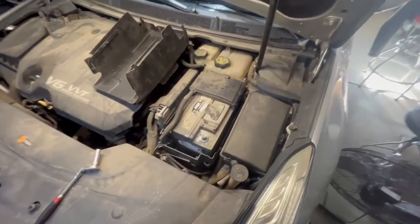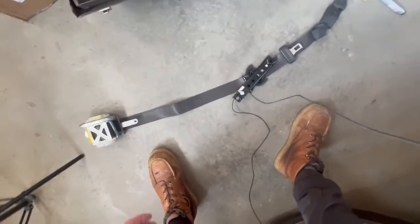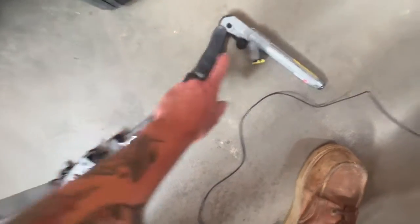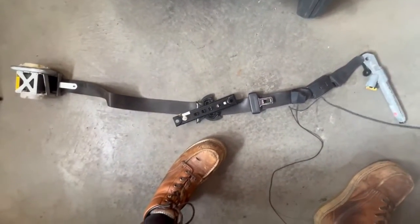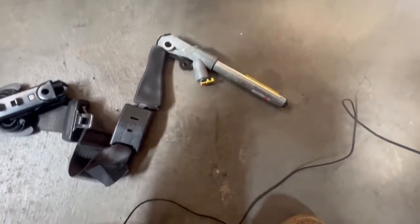When you're trying to source the seatbelt, if you're anything like me, you're having a heck of a time. This section of the seatbelt is known as the retractor. There are a couple things that we want to look at to make sure that the seatbelt hasn't been in an accident. One: this shouldn't rattle — doesn't rattle. Two: this part shouldn't be all bunched up. If it's all bunched up, then it's been in an accident and it's worthless to us. But the computer will know that right away because it'll show as an open circuit. As soon as this thing deploys, it's an open circuit.